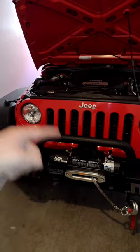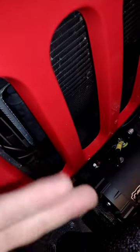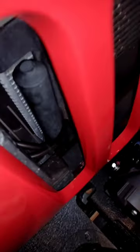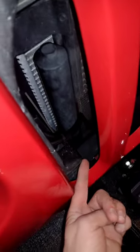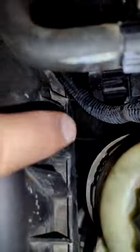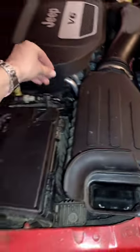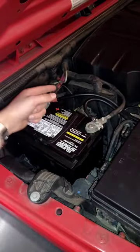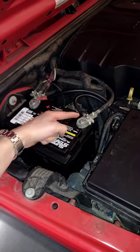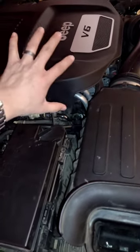Once you have your winch mounted, the next step is to get power to your winch from your battery. On the backside of your winch when you were mounting it, make sure that those two long black and red positive and negative wires came out the bottom. I fished them through the red portion of my Jeep here underneath the frame — you can see them come out right here. I used a zip tie to hold them together and put them around the passenger side of the radiator. I had someone push them through, and I with my left hand stuck my arm way down underneath the air intake, grabbed them, and pulled them up to the battery. From there it was just a matter of connecting the red wire to the positive post and the black wire to the negative post. I also used a zip tie to hold the wires up on this side of the engine bay, away from the heat of the engine block.